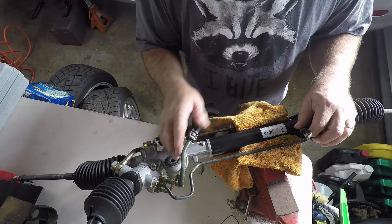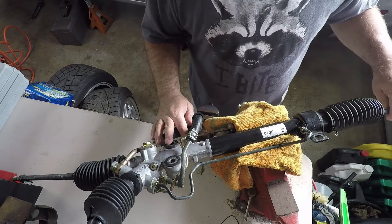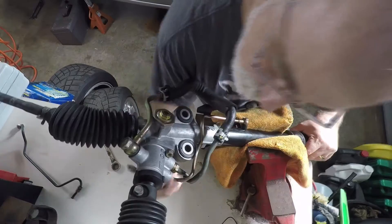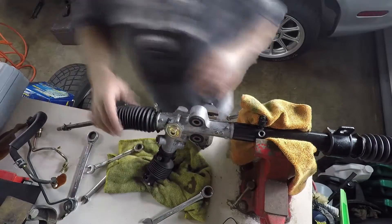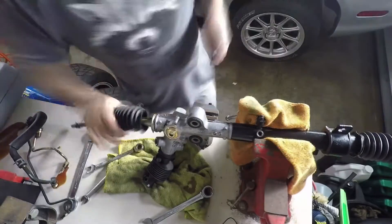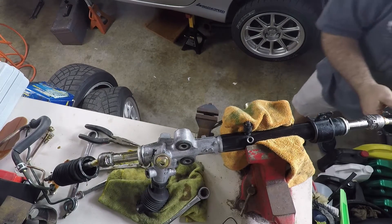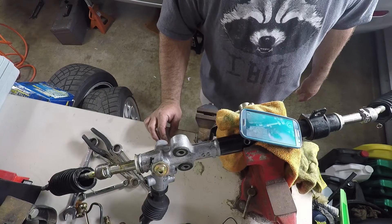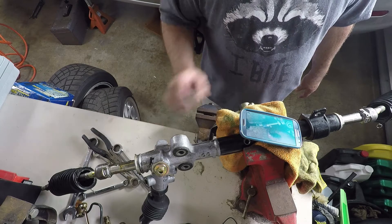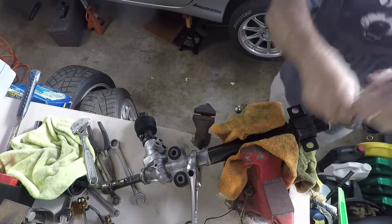There's my rack. First thing I'm going to do is get all these little tubes out of the way, get that all the way, and then we'll start disassembling everything else. A little flat head or a punch and a hammer — just kind of hit these until the tabs fold up. These tie rod ends, inner tie rod connectors — this was a pain to get off.